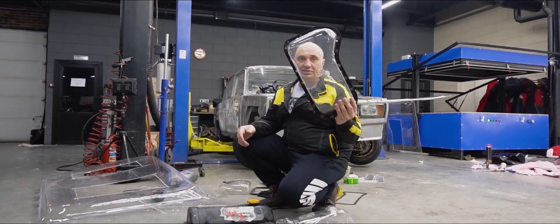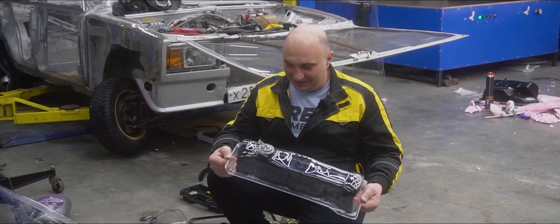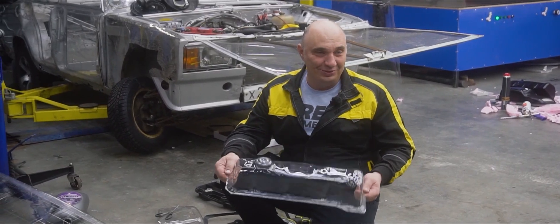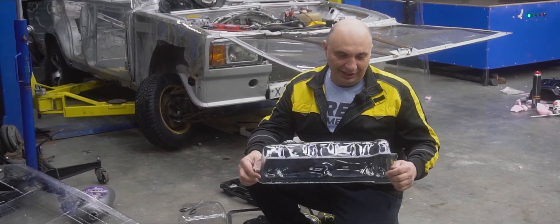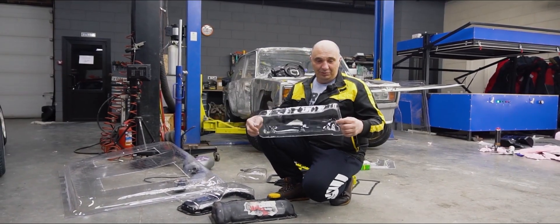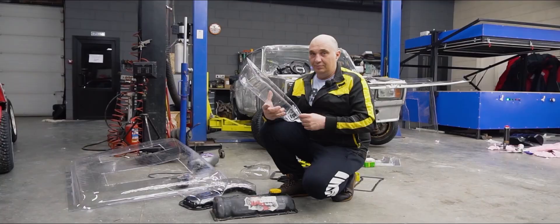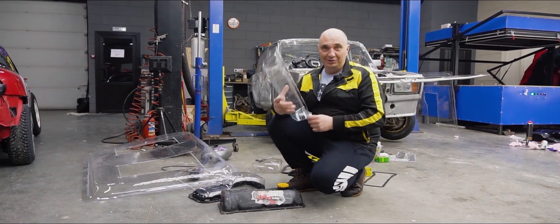It's still very much transparent. We went in a slightly different direction with the rocker cover — it's not subject to any serious pressure or being pushed around, and minor oil leaks we can live with. We're going to try securing it with some windshield sealer, which is pretty sticky stuff. So let's throw the sump on first, pour in some oil, then we glue on the rocker cover and fire up the engine. Let's do this.